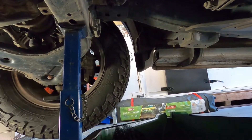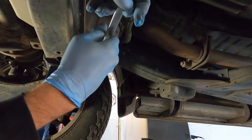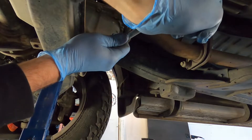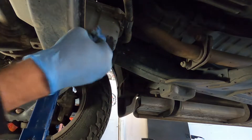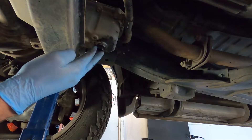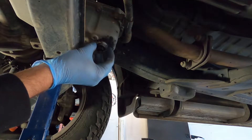I'll show you how tight to do it up - especially on an aluminium one you don't have to go crazy on it. These have a lot of threads so you can go a little bit tighter than some sumps. Do it up finger tight first, then get your 17mm spanner and do it up until it's firm, then go about that much further - and that's it. You don't need to hang off it. That bolt's not going to come undone - remember it's only holding oil in, not holding a wheel on. You're only going to damage the threads otherwise.